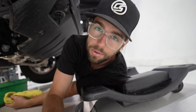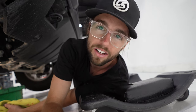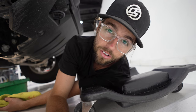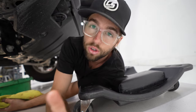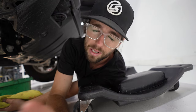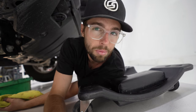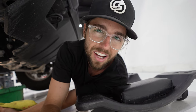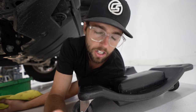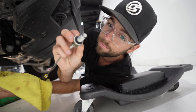If you're new and wondering why oil would drip from the drain bolt: if you over-tighten the oil pan and strip that bolt, you're in a world of hurt. So you always want to err on the side of too loose rather than too tight, but never loose and never over-tight — find that sweet spot. Sometimes you snug it up and three days later it's dripping oil because there's some grime, it doesn't have a good seal, or there's no factory washer — usually a copper one — to keep it from leaking. So when you see one with a rubber seal, that's exciting.